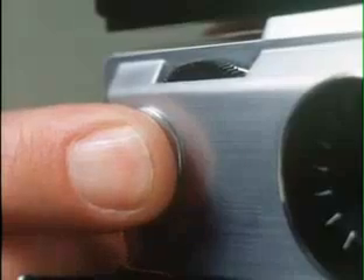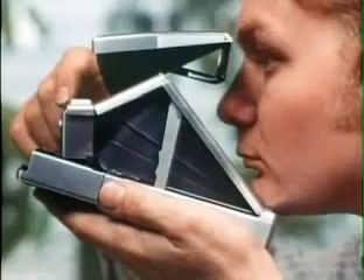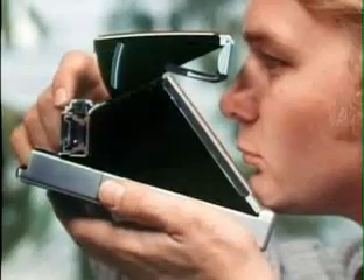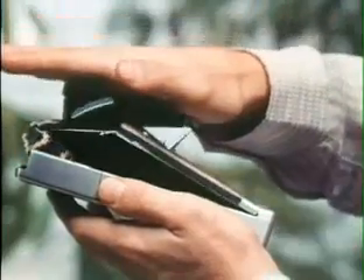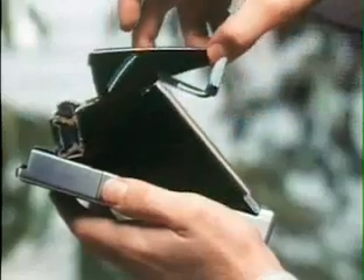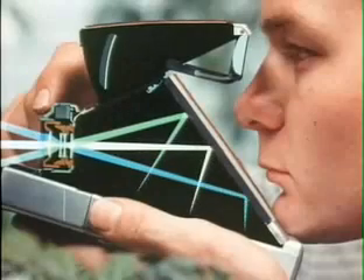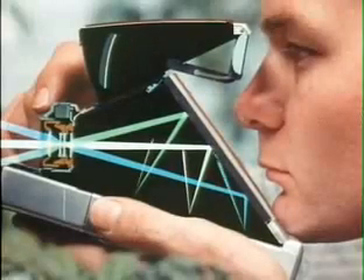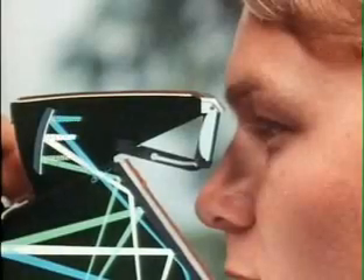During the one and a half seconds after the shutter button has been pushed, and even during viewing, another story is going on inside the camera. This optical path from subject to eye is unique to this single-lens reflex system. All elements are articulated to fold into a compact unit that folds flat. The four-element lens collects the light, which bounces off of a permanent mirror to a fine fresnel surface. It bundles the light and reflects it back again to the same mirror. The light leaves the interior of the camera through two astigmatism-correcting slits, bouncing off of an aspheric plastic mirror.